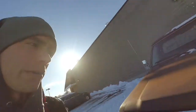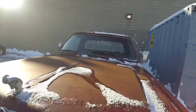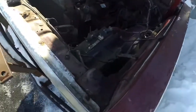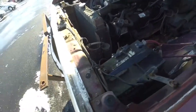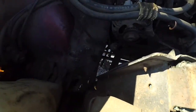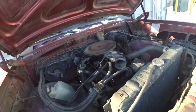We're out here today to do some further diagnosis on the RAM. I've been realizing it's still pretty hard to start, partially due to the battery that's in here being ancient and needing to be replaced. So I've been jumping it with the Durango. The other reason I think is that the old fuel filter might be a little bit clogged, slowing fuel delivery up to the carburetor and making it harder to start.